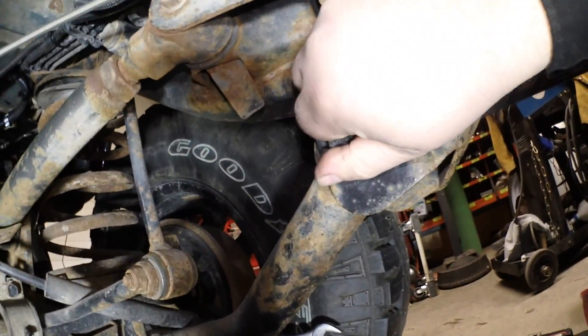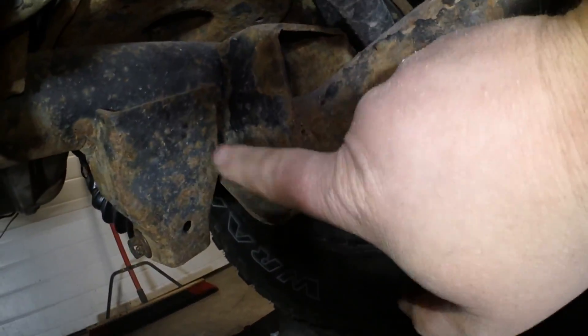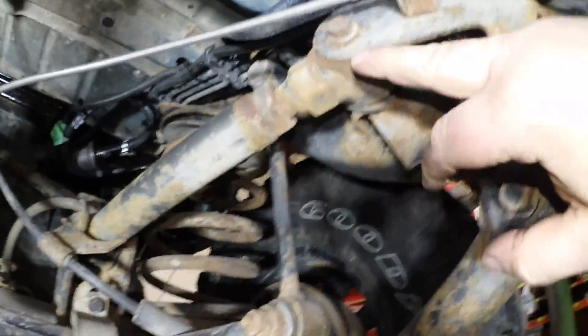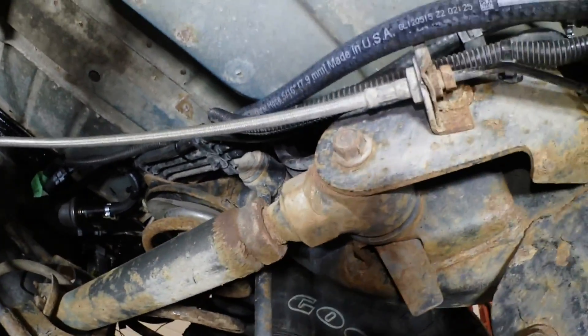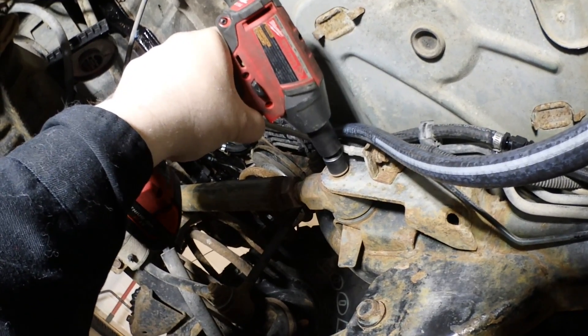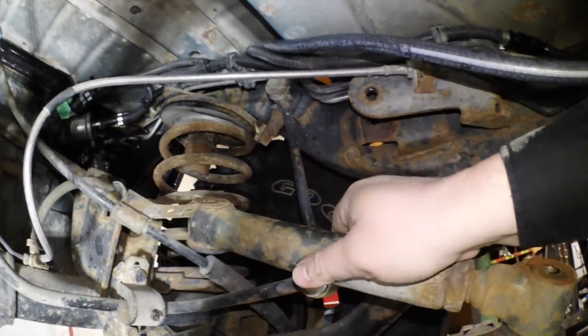One of the things you've got to do is loosen up the lower control arm bolts to make it easier to twist the axle. When you're ready to set the alignment, then the upper control arms - if you're doing this, you have to have adjustable upper control arms, otherwise it will not work. I'm going to be in the process of pulling the upper control arms out.